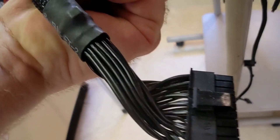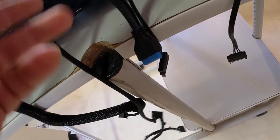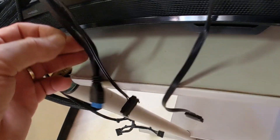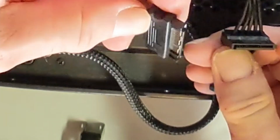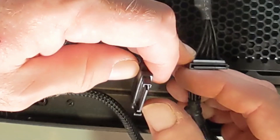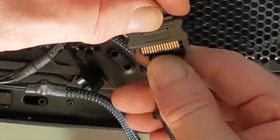As I attach each cable to the PSU, I slip the rest of the cables out of the way to the back of the case where cable management happens. I start from the far end so I don't have cables in the way as I plug into the PSU. Some of these are the cables from the control panel of the case — two of them hook up to the PSU so that the case fans, the RGB, and the case control panel are powered. Note the keyways that most computer connections have — this one prevents the SATA connection from being installed backwards. When you align them and press them together, you'll feel a click connection.